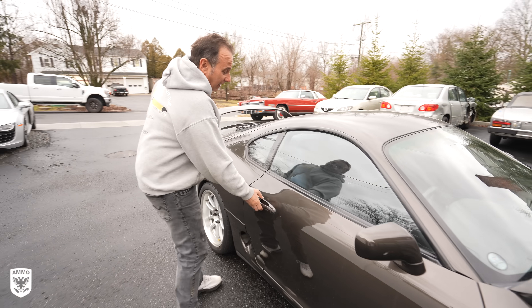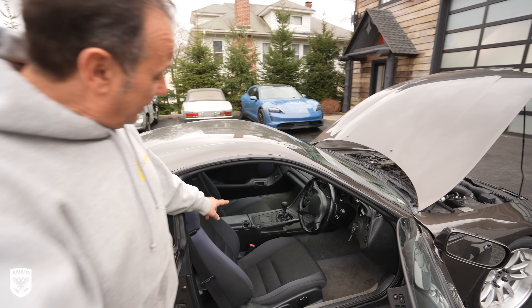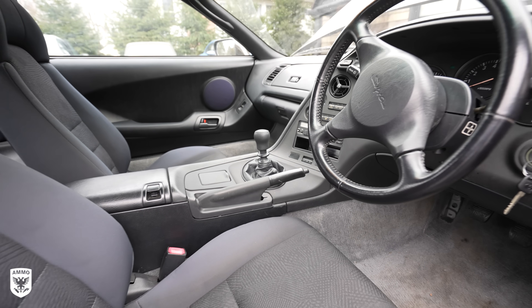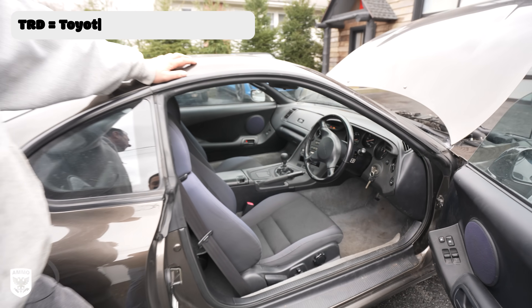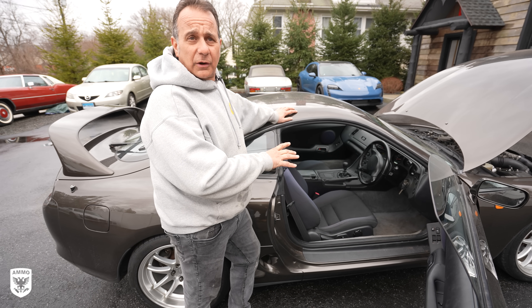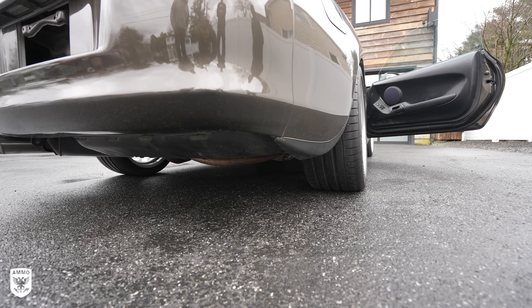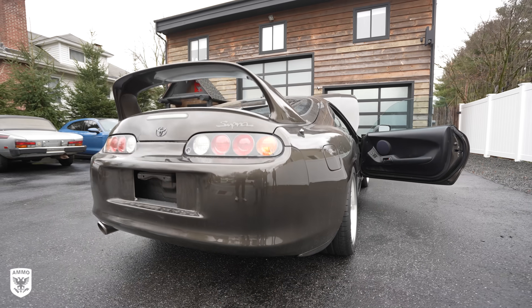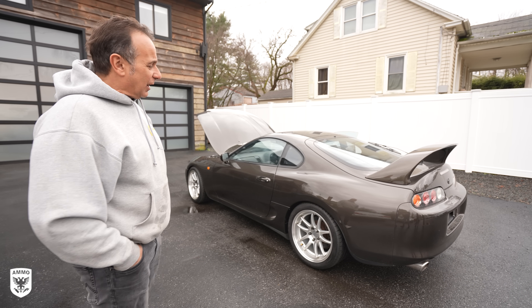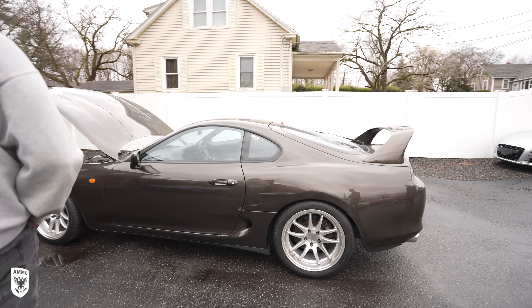The cool thing about this car is it's right-hand drive, which is kind of fun to drive on American streets. If you go inside, you'll notice it's a six-speed manual. The car originally started as an automatic but we bought a brand new transmission from TRD and put in the six-speed, modified the tunnel properly with Toyota parts. It came out really great. We're running 295/30-18s — they fill the fender wells pretty well and it might be a candidate for some modifications.